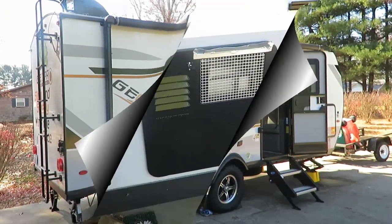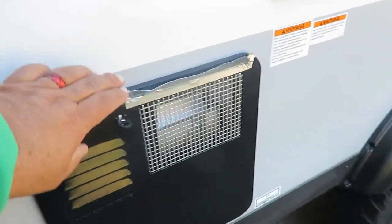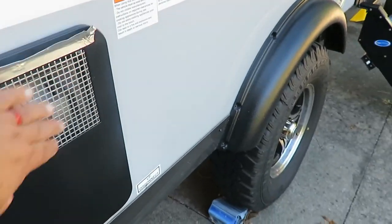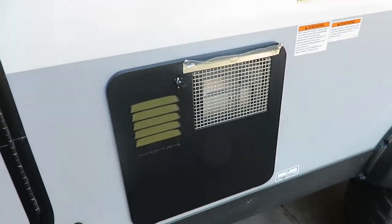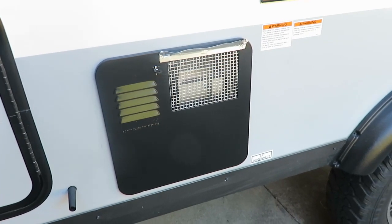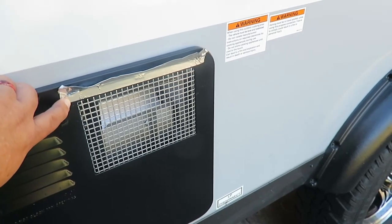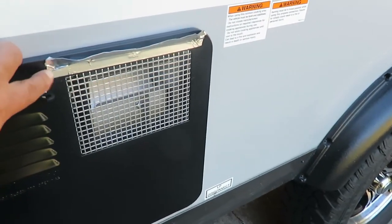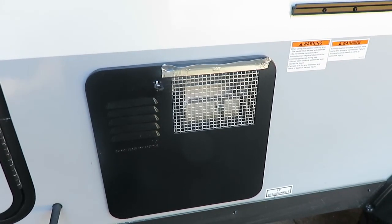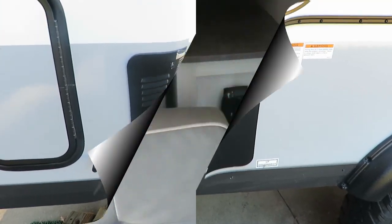One of the experiments I did was putting tape on here as a deflection reflector to deflect the heat out of the water heater whenever it's running on LP. A couple of people have told me about using a piece of metal and riveting it on, so eventually I'll pick a piece of tin and put pop rivets on each side to make it more permanent, because it does work and I want something more permanent.